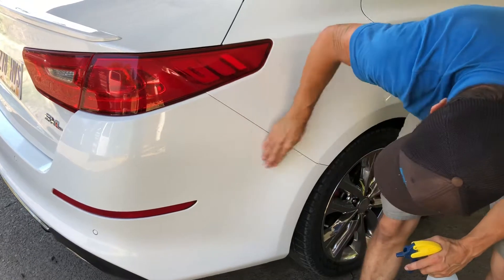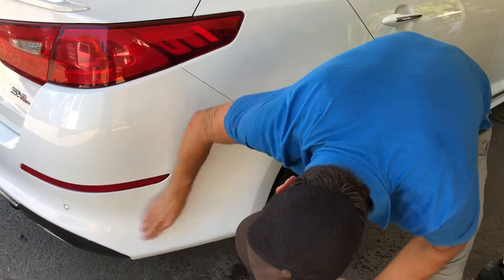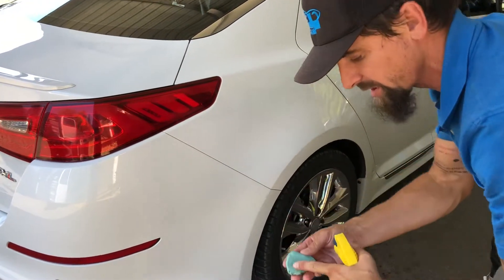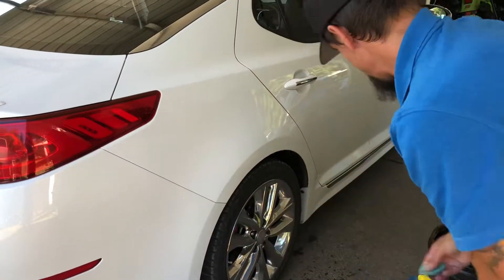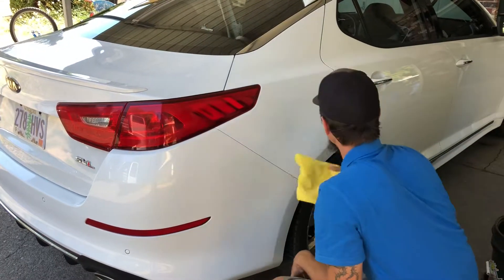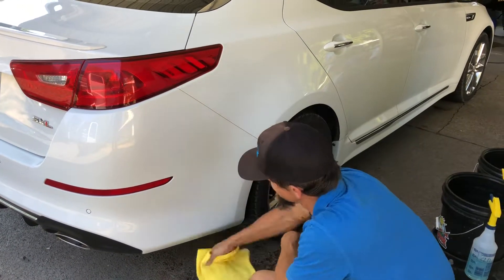As I'm doing this, I'm looking for other imperfections along the vehicle that I might need to spend a little bit extra time polishing or something like that. You also notice I went from the top to the bottom — that's one thing that I think is very important because you're going to get heavier stuff off the bottom. I don't want to go from down here and work my way up because you might get stuff in that clay bar. Now I'm going to hit it with a clean microfiber and just mop it up. I'm barely touching the surface, just enough to get the water off of there. I'm not scrubbing — there shouldn't be any dirt coming off because we already cleaned that up.